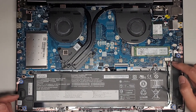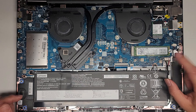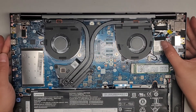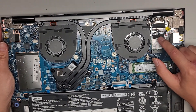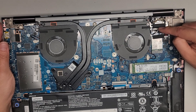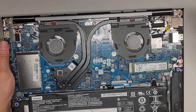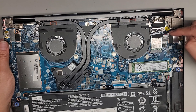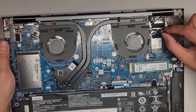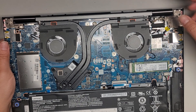You've got the battery connector here, which we're going to have to remove first. We're going to take out the battery, drain the power, and then replace the screen. You've got the wireless card here — there's a screw underneath a foam piece, and the wireless antennas pop off from the tails. You've got the LCD LVDS connector. If you are going to remove that, make sure you disconnect the battery, open up the computer, and press and hold the power button for at least 15 seconds to drain any residual power. Otherwise you can short your computer, or the voltage jumping across can fry the backlight circuit.